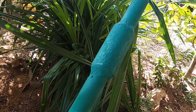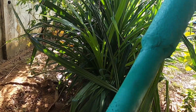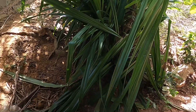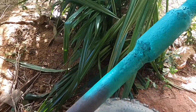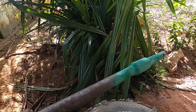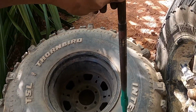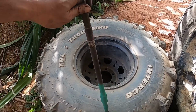It is sleeved with a piece of drag link from a 106 Hilux, and underneath is just butted up, bevel and weld. As I saw, I put it on the lathe and weld it. There's a bit of a run out where the welding is, but both ends seem to be running true as I was on the lathe. It's just the shaft has a bit of bow in it, but very slight, that won't cause any problems.